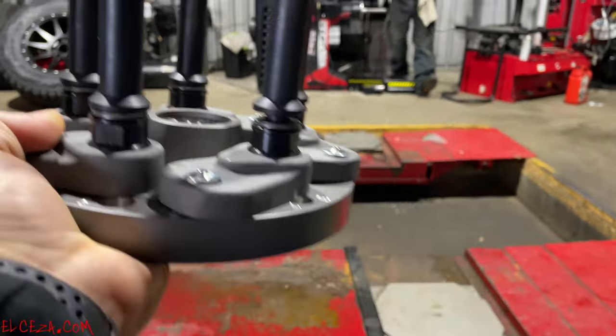Okay, so it wants that 0.75 there. We're gonna put it here. We're gonna go to the double weight. So it wants 0.75 there. We'll put the weight on and move on down the road. Everybody with me on that? That's getting into balance of tires that we really don't need to talk about, other than don't beat on a balancer to the beat of the music that's in your ear.